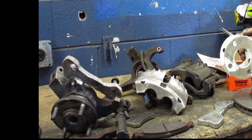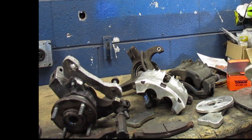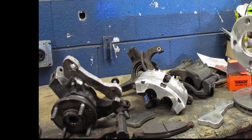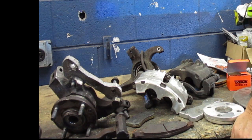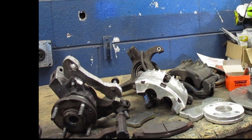I made some 3/8 inch spacers — if you space out the wheel 3/8 inches, even the stock MX3 15 inch wheel would fit without rubbing. I also bought some lightweight racing wheels that cleared without spacers. The Miata wheels I've used in the past would barely clear without spacers, but with the spacers they clear no problem. The stock MX3 wheels will not fit at all without spacers.